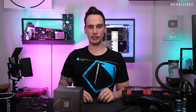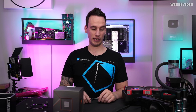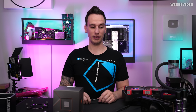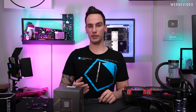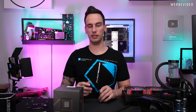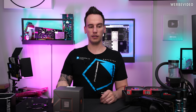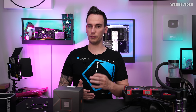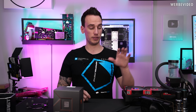After seeing those results initially, I thought that's kind of unreal. And I double checked and triple checked literally everything. The mounting, I checked all the settings, I checked if the performance is there, but you could even see this yourself. If you go back and watch it in detail, you will see that the performance in R20 is identical. So it's not like some cores are clocked to a different level, and also the voltages are identical. I'm running the same BIOS.